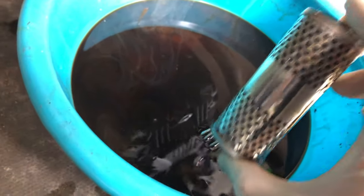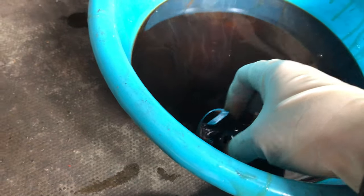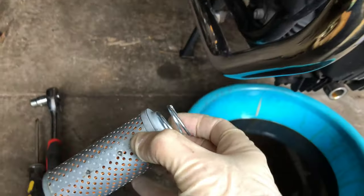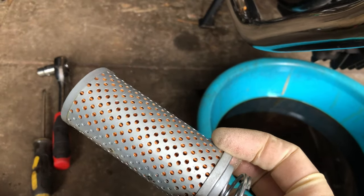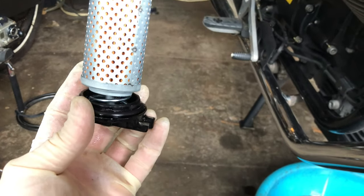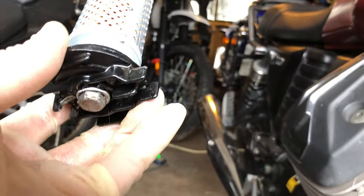That's the original cartridge oil filter. These are pretty much the same across all the small block engines — they all use the same oil filter, right back to their first V50. This is a nice new oil filter, pink inside and not yet gone black. You can see the spring with the oil filter on the cap. Now put the bolt up through the middle and shove that into the engine.